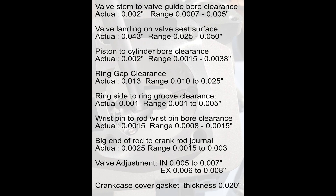On this chart I just put up, you'll see the actual measurements I took on the clearances on my particular engine. I've seen at least two different versions of this small diesel, so I'm not a hundred percent sure all the components would be the same as mine. I decided it would be better to give you guys a general range of clearances instead of individual component measurements. If you measure your components and they fall within the range you see here, that is generally considered acceptable for a rebuild and should sustain reliability for quite some time. It's not super specific because I have no idea if your engine's going to be identical to mine, but it should get you in the ballpark.